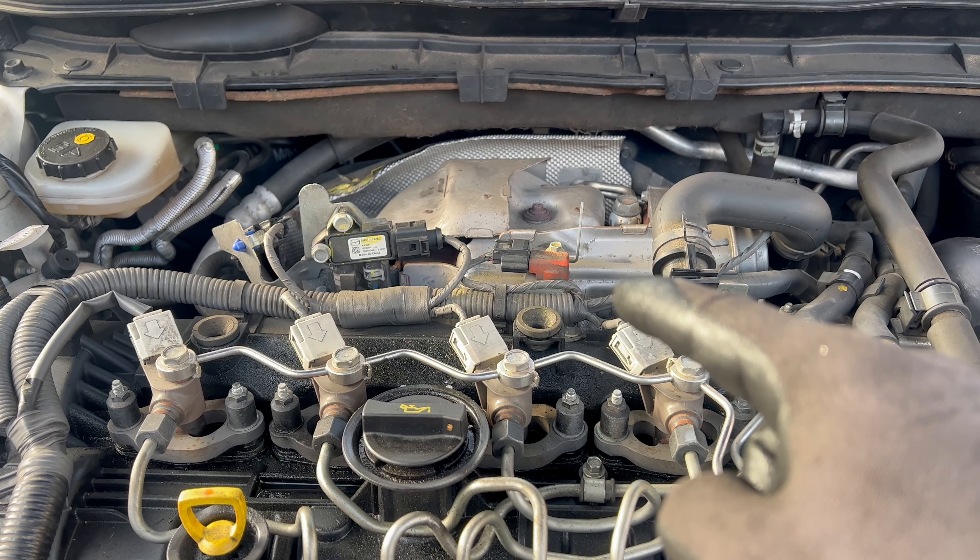The pipe is removed. I connected back the sensor just to show you and check the live data to confirm that the sensor is bad. Now with it removed, it should read 100 kPa, which is one bar — atmospheric pressure. But it still reads around 74 kPa. I have my MityVac here to apply pressure while checking what the sensor reads. When I apply pressure it rises, but I only have maybe 25 kPa applied and it is showing nearly 100. Going further, it now shows 158 kPa in red, and we are not even at 100 kPa applied. So I can confirm that the sensor is bad.